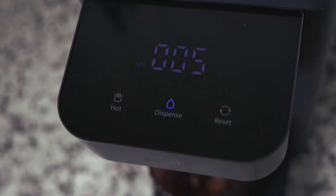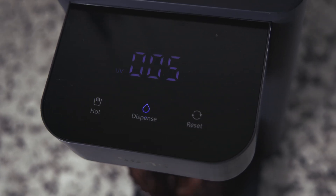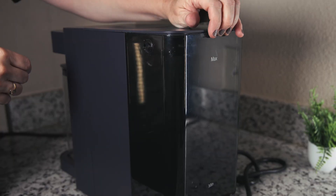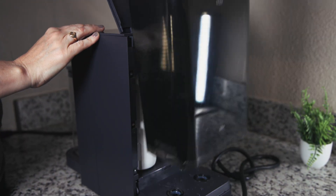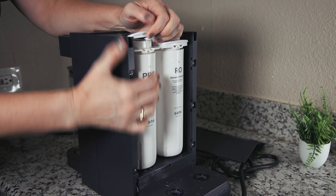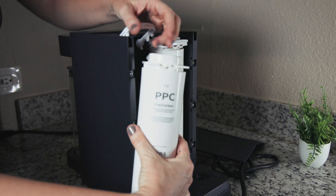We really like the SANS display — the buttons are responsive and there's a built-in TDS monitor, which our testing found accurate enough to help you track filtration performance. There's also a filter life indicator that lets you know when it's time to replace the filters, usually somewhere between 600 and 1,200 gallons, or every one to two years. And replacing filters is super easy: remove the top cover, flip the switch that locks each filter in place, pull it out, and reverse that process to insert a new cartridge.